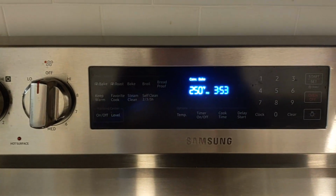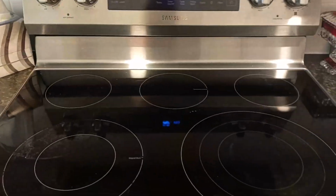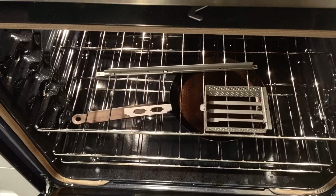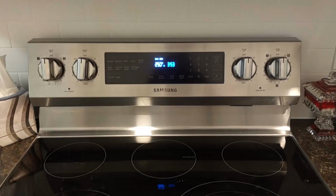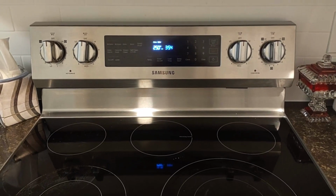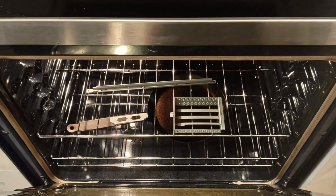So I've also got my oven hanging out at 250 Fahrenheit, which is a little bit over 100 Celsius. And no, this isn't a cooking show. I am baking the metal parts, which I also washed in dishwashing liquid and water, just a real mild mixture, just to get all the dust off. And putting them in the oven like this ensures that they dry off without rusting. I've already done this with the case. Seems to work pretty well, didn't affect the stickers. And it makes sure that there is absolutely no rust on these from me washing them.